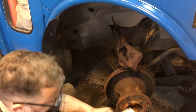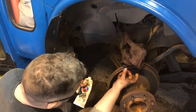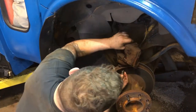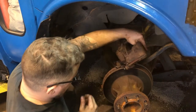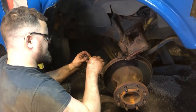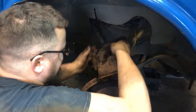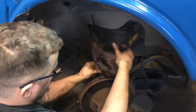A little more. And you're gonna be using brake grease, high temp, silicone based. Put a little bit inside those new bushings. And slide them through. Another one. Ooh, too much. Squirt it out of there. Coat them up real good. Popped in there. And you want to kind of flush them out so they're not in the way.